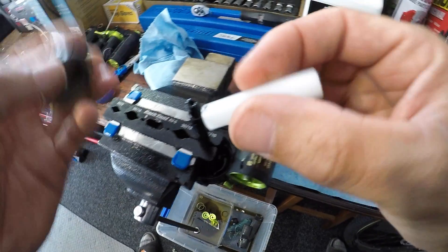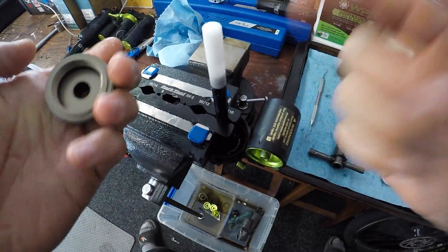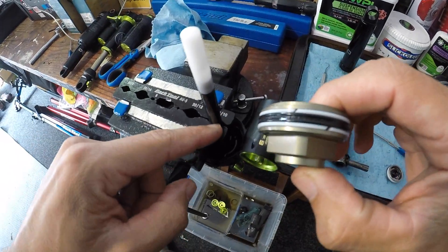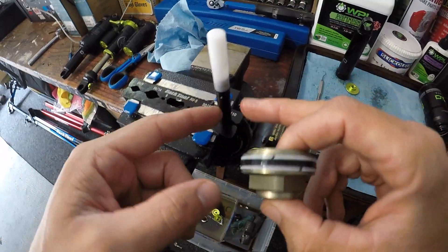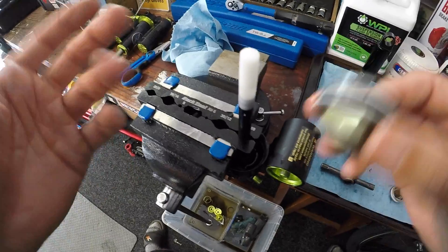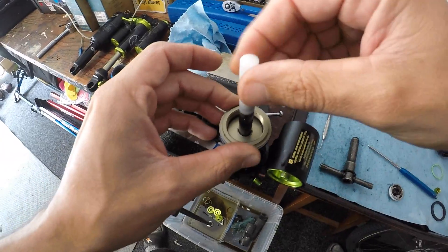I have this really handy little bullet tool that basically sits onto the damper shaft and allows me to slide the seal head over the bullet tool, down onto the damper shaft. It's a lot easier that way. If you're only doing one of these every six months it's a bit fiddly to get it on, but it is doable. Because I do a dozen or so a week, I have a specific tool. We just slide that onto the top and pop it down.